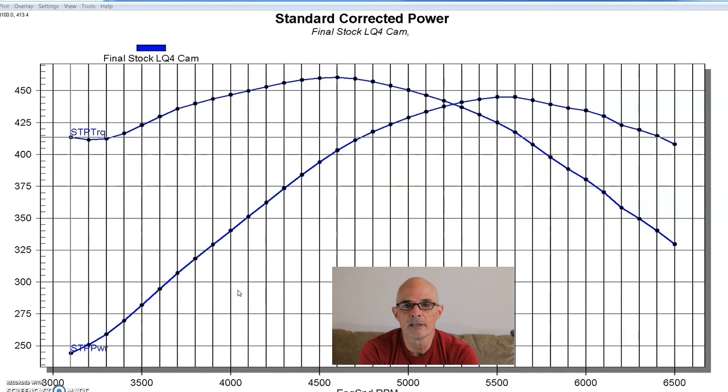We went over all that beforehand. But it's important to note that when you're testing these camshafts and you're going to run something like this Stage 4 cam from Summit Racing, you'll want to check piston to valve clearance, because every LS combination is different. Obviously, when we test it in a 5.3 liter, that has the smallest intake valve. It's a cathedral port head. The valve drop on that head is different than on the 6.2 liter, because the 6.2 liter had rectangular port heads and a bigger valve, different valve drop. The piston could be in a different position. They're different pistons, so you really need to measure it, because you're getting close with a cam like this, and it's important to have enough piston to valve clearance.